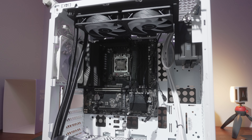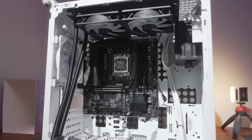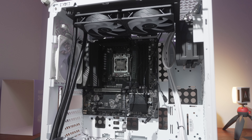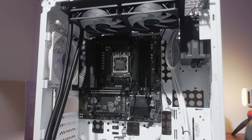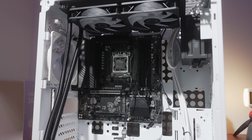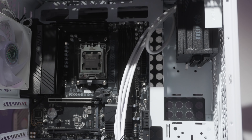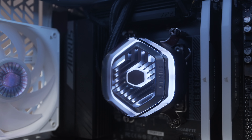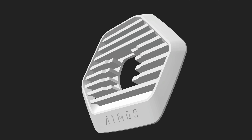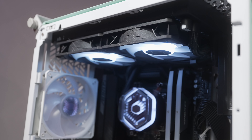Building the insides as you build up the outer panels gives the easiest access and the most streamlined process, though you can also build it like any other pre-assembled case after completing the outside. For this build I'm using an mATX Gigabyte B650M Aorus Elite board with a Ryzen 5 7600X and a 4070 Founder's Edition card. Power comes from Cooler Master's SFX 1100W unit with stock cables, which are still long enough for this case. Cooler Master also sent their new ML240 Atmos AIO, which features pre-installed Sickle Flow Edge fans and a customizable 3D-printed pump top cover.